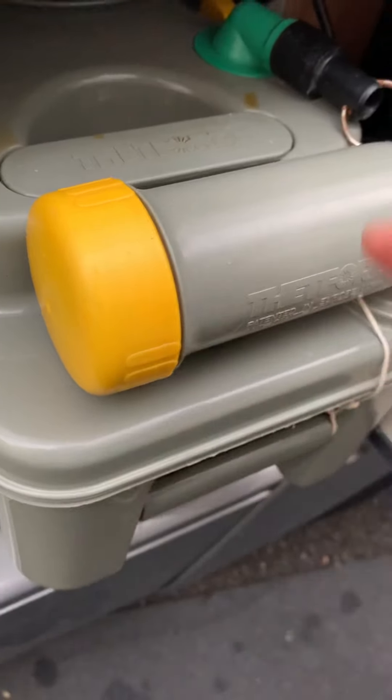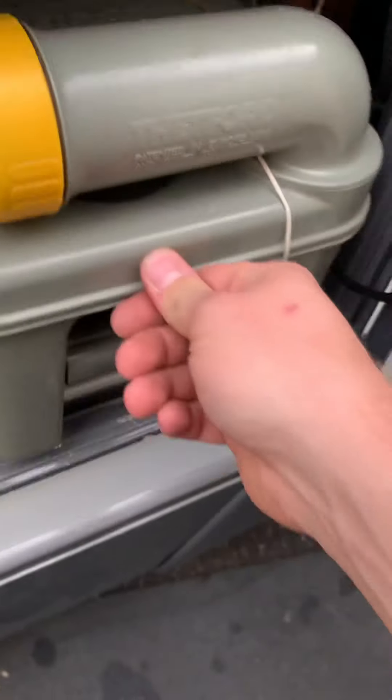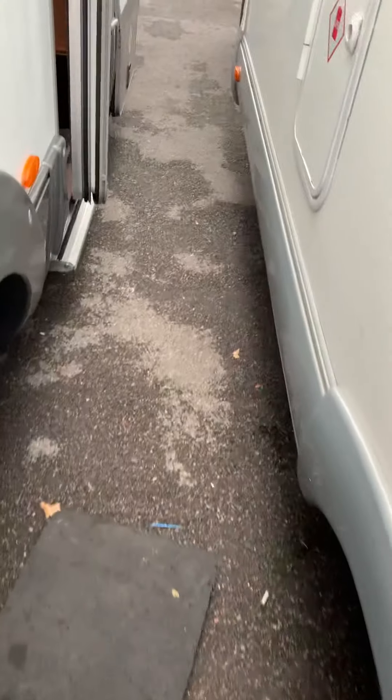You've got your toilet cassette locker — push both buttons in to open it. Lift up on the bottom and pull it all the way out. Hold the yellow button down when emptying it, then fill back up with blue fluid. In the rear locker you've got your boiler, and there'll be a drain-off for that — I'll show you that inside.